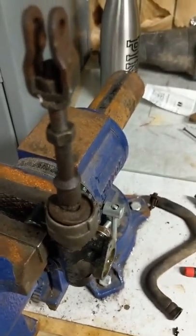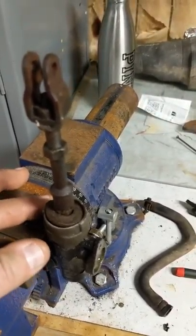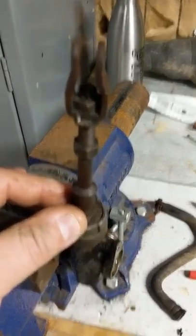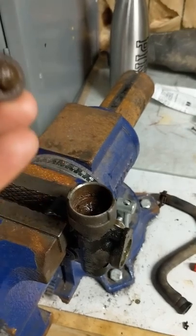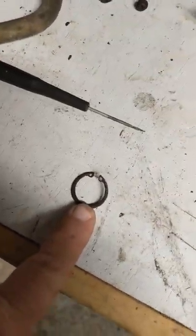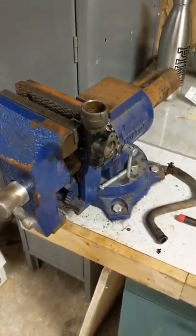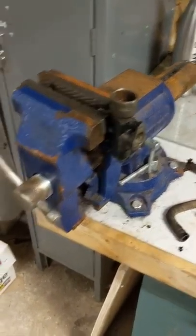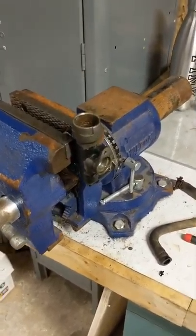My brother has that; I don't have it here with me or I'd show you. But once you get that rubber boot off, that's when your problems will begin. This looks real easy right now because I just pulled it out, but it's actually held in there by this snap ring right here. And unless yours has been rebuilt before — these quads are like 30 years old now — it's going to be frozen in there. If it's not, you consider yourself lucky.